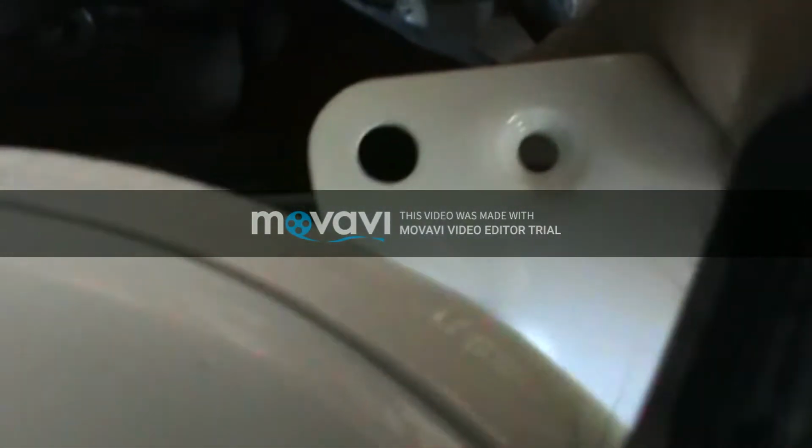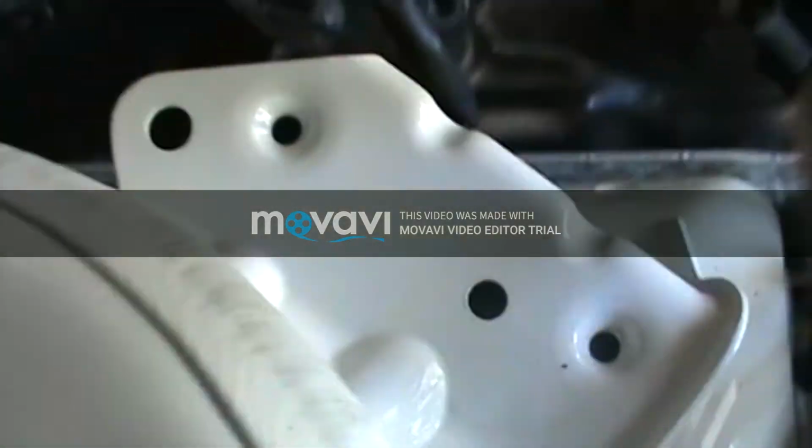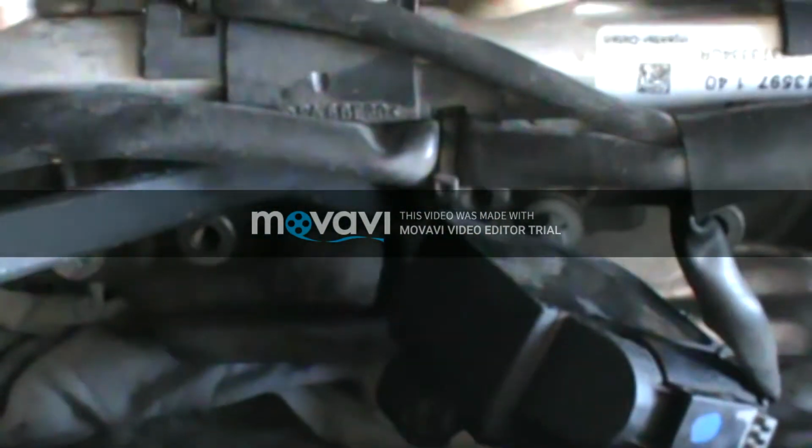Now I wanted to try and show you, when I got to the rear, it's really hard to get my hand in there. That's probably the hardest part of the job, I think, is getting the spark plug boots off, because you've got your hand down there, you're trying not to mess anything up. It's plastic, rubber. So what I did, most of them I would pull the coil pack over to the side, moved it towards the front. I could get my pry bar in there very gently on the spark plug wire, just putting enough force on it to pull it out, to force that out a little bit, and it would pop that off.